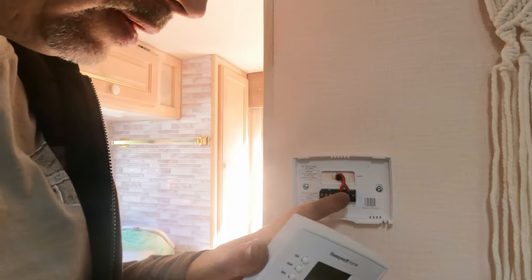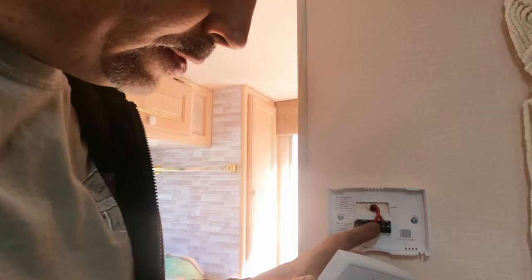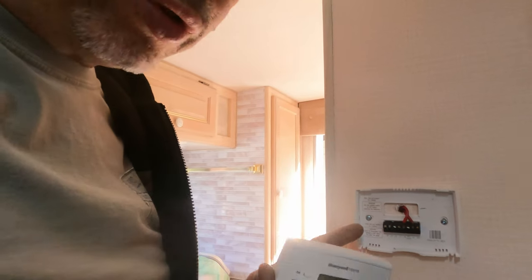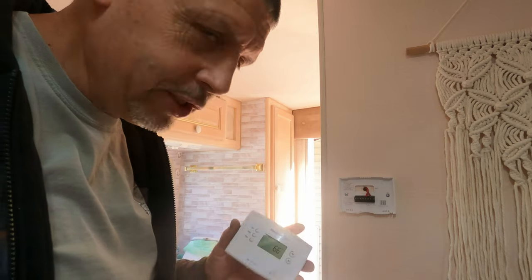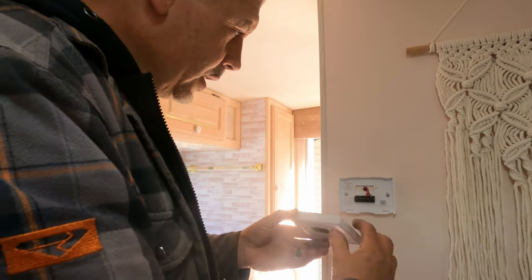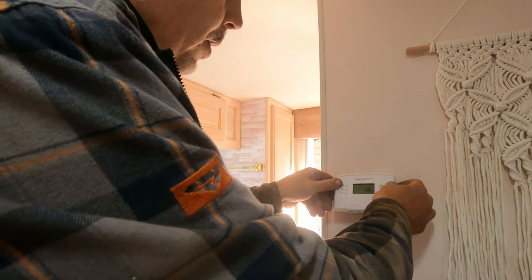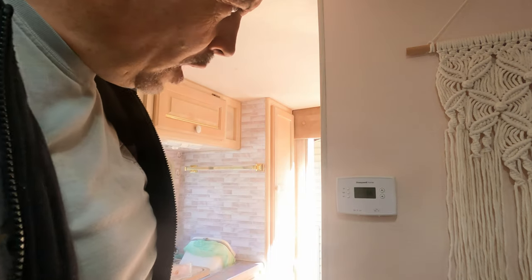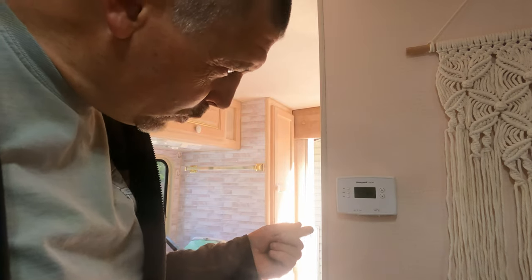I've hooked up the R — the 12-volt positive — and the W wire to the thermostat and screwed it to the wall. I didn't use a level because your camper has to be completely level to use a level, and really, is the camper ever completely level? It's close, but I just did a looky-level so it looks level. This thing just pushes on, and I have two batteries in there that retain memory when there's no power coming in.